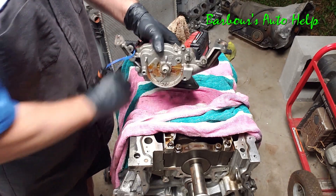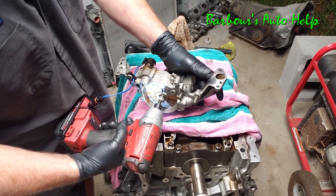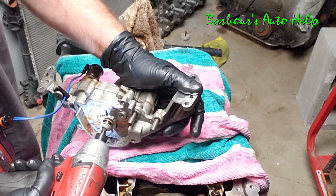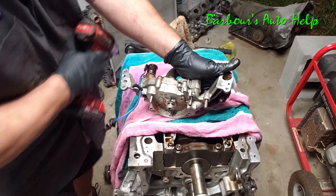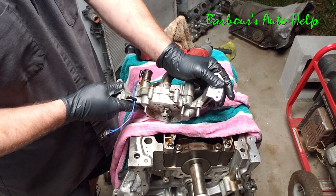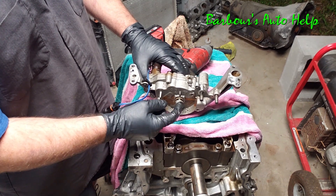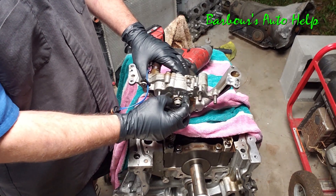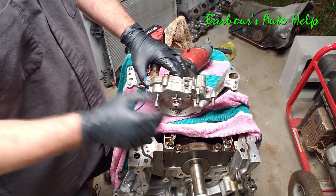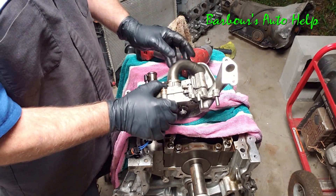Let me put my impact on there — it's pumping air right now and whenever I put my finger over that hole it pressurizes, and when I release it gives a little. As I mentioned in part one, this is actually driven by the timing chain. There's a sprocket that bolts up right here and that timing chain spins it, which causes it to pump. We're going to dissect this and see how it actually functions.